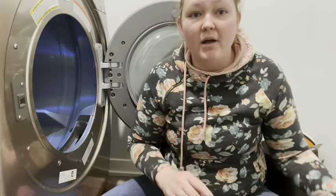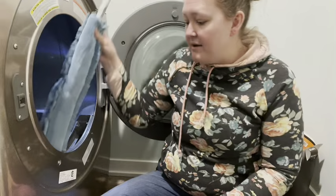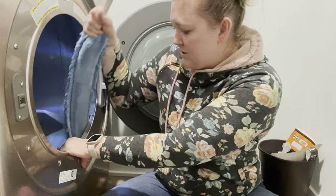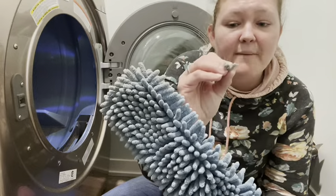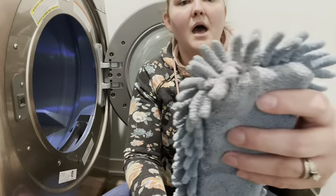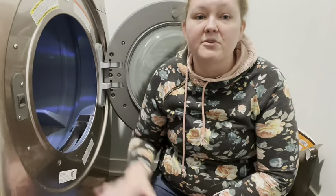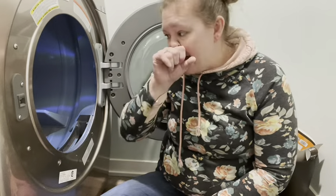The next thing I always do, and I do this about once a month, not just during spring cleaning, is I want to make sure this trap in here is nice and clean. So I just take my enviro wand — anything you can get down in there; they make attachments for vacuums — and you just go down in there a couple of times to make sure you pull up any lint. Sometimes that lint does miss the lint trap and goes further down in, that's why you want to make sure you're getting it cleaned out with your enviro wand or a vacuum attachment. Not only does it help prevent fires within your dryer, it also helps prevent your dryer from working harder than it needs to and causing that motor to burn out faster.